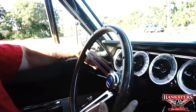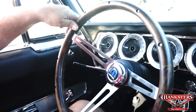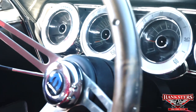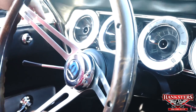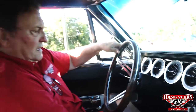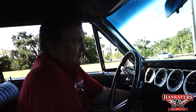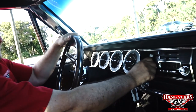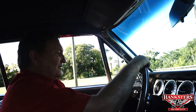Fuel gauge is working. Speedometer is working. Amp gauge — charge and discharge — is definitely working. Tachometer is not functioning and the oil pressure gauge is not working — those need to be fixed. Horn is working. Turn signals — left and right — are definitely working. Wipers are definitely working. Radio — AM Dodge radio — it's working. Remote mirror works fine. Let's put it in gear and go for a ride.